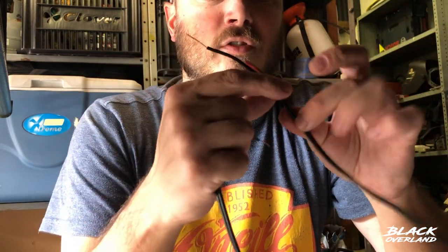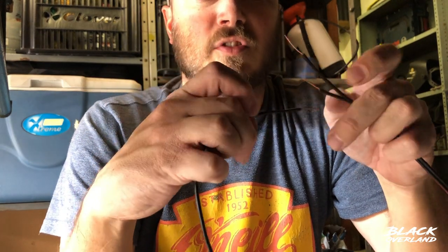The twin flex I pulled through the grommet isn't quite long enough, so I'm going to extend it. When I cut the positive and the negative, I just cut them with about an inch between them. That way when connecting the opposite positive and negative together and you solder the copper together, there's no way of the two copper wires touching — it's just the rubber, so there's no chance of short circuiting. Before I start soldering I'll put a heat shrink over — that way it'll just seal it nicely.